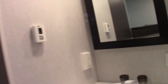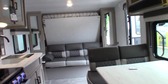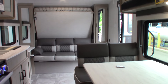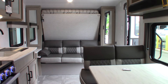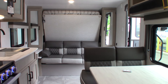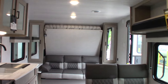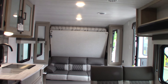Thank you for purchasing your trailer here at National RV Detroit. Remember to inspect the roof every 60 to 90 days — that's important. The trailer is in camping mode: the antifreeze has been purged from the system, the water heater valves are in the correct position for camping, and the antifreeze has been replaced with water, so you're all set until you winterize in the fall. When you pick up, we'll go through the hitch setup and answer any other questions.